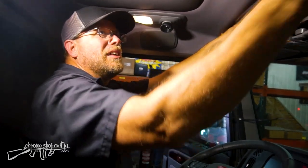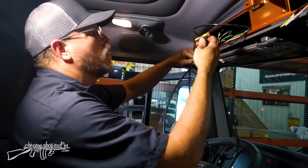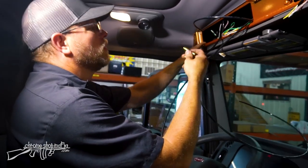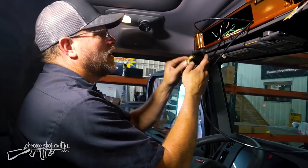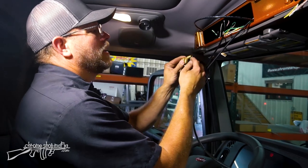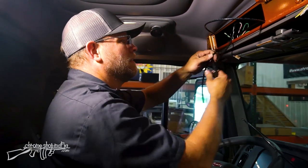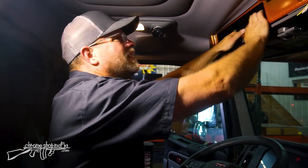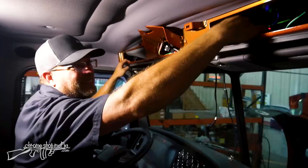I need to connect the line from the horn to the port on the valve. Here's a T-fitting — both horn ends come in from the sides and the line from the pull cord valve comes in the center, so the air gets equally split going to each horn. If the supply came in from one side there'd be more pressure going to whichever horn is fed off that side. I'll cut the lines, attach them to the T-fitting port, then give a little test pull — that works just like we need.